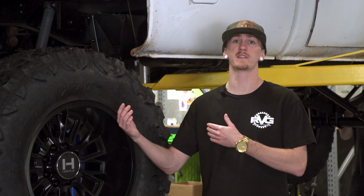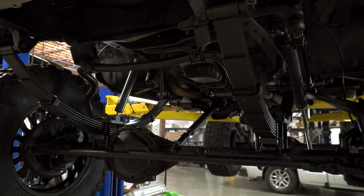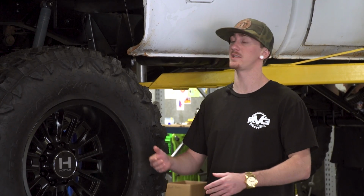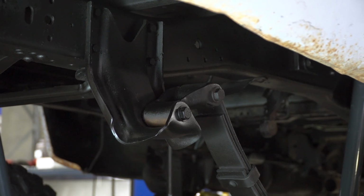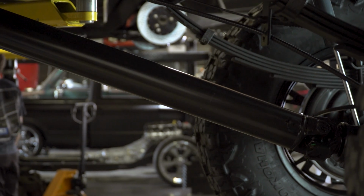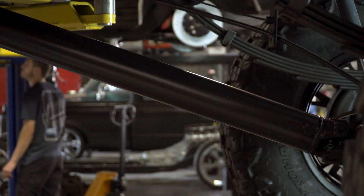Some of these trucks come with a 56-inch leaf spring pack or a 52. Superlift makes all theirs for the 52. If yours has the 56, you just have to move that rear hanger to the other available spot 4 inches forward. When you do this kit, you do have to lengthen the front and rear drive shafts. It does come with the Shadow Series Superlift shocks as well.